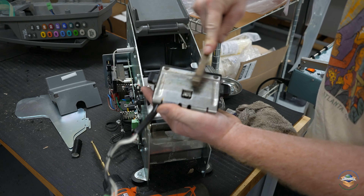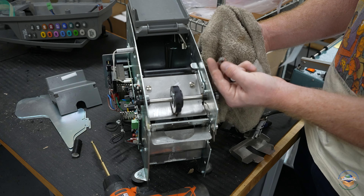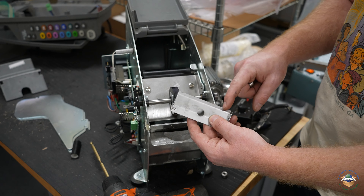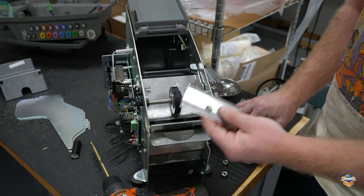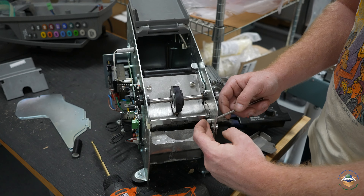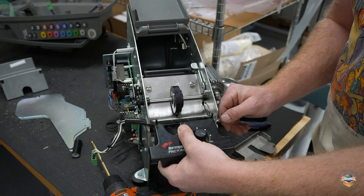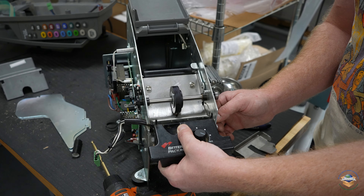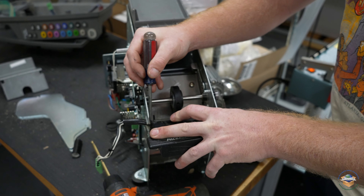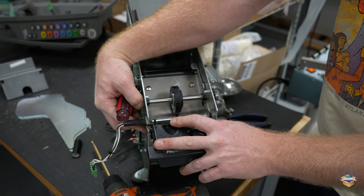I'll clean up these little cracks here on the side — make sure that's clean. You want your tape to go across a smooth surface here. Your bearings here — you've got two of them — make sure they're clean. If there are any flat spots on them, replace them. This lower heater plate is a real important piece on this machine — I've seen it cause a lot of jams, so I've got a new one for this repair. It snaps onto the bottom of that heater. Grab your shaft and one of these rollers, push that blade back, set that in place — that'll hold that blade there. Make sure that power cord goes through the gap on the side frame. Now I'll push the shaft through until it's on the other side, but not going through that lower heater plate. Drop the other roller in there — you may need to take a flat head screwdriver and push that roller back until it's through to the other side, flush with this other side.